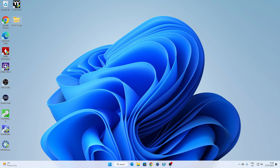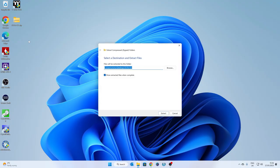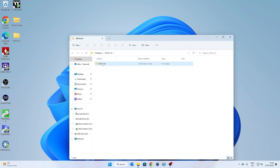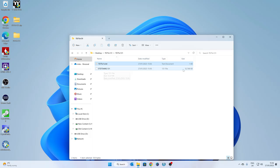There's our downloaded folder, which is zipped. You'll need to extract it — right-click and choose Extract All. I'd recommend using the Windows built-in extraction tool, as I've had a few issues with WinRAR previously doing this. Extract it straight to the desktop. Inside the folder you've got a text file and the BIOS file. The BIOS file should be extracted to a file size of 32,768 kilobytes for this particular board, and it's currently named as a 131 file.